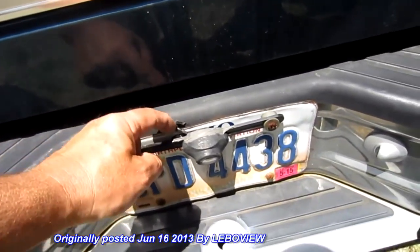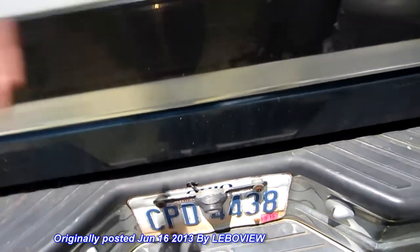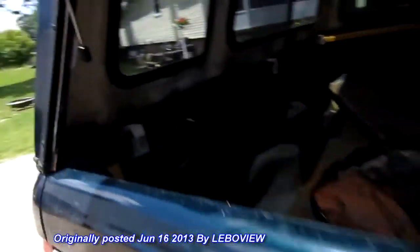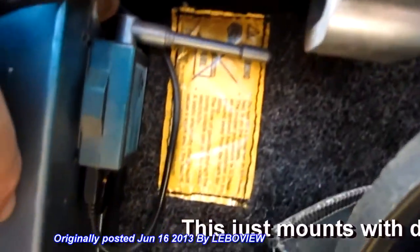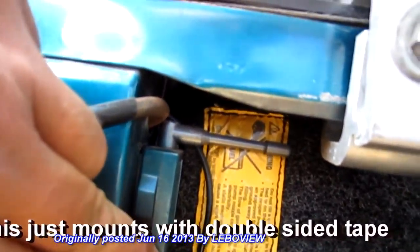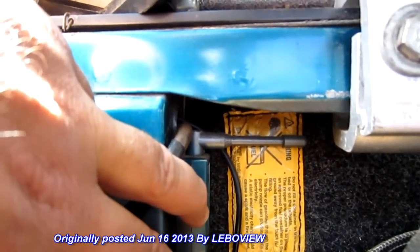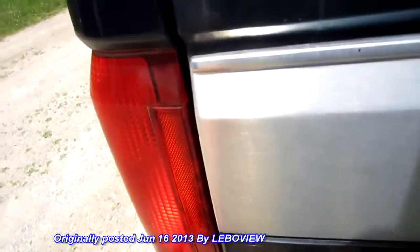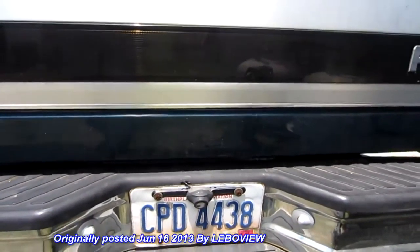Then I run the wire inside — I didn't have to do this, I just decided to do that on my own — to run the wire through the fitting there. And then I mounted the controller underneath here. That's the sender that sends the signal up to the unit in the cab. It's real simple to do. It wires into one of your backup lights — you just take out a couple of screws on the tail light, pull the tail light out, and it gives you a scotch lock connector that will allow you to pinch onto the wire. Whenever you put it in reverse, it turns on the power to the camera and gives you the picture that the lens shows you.